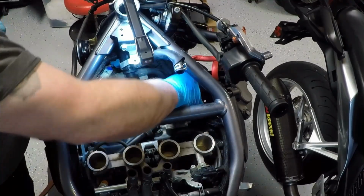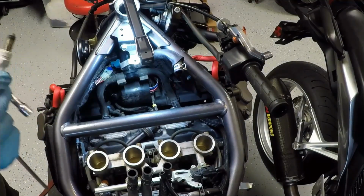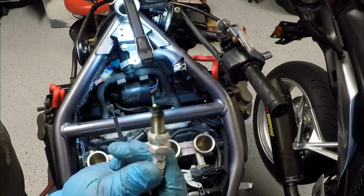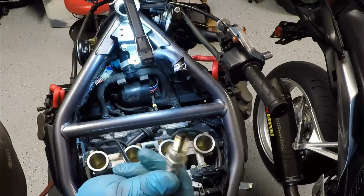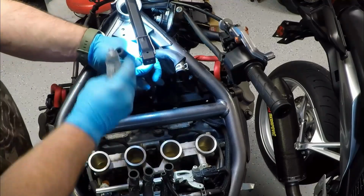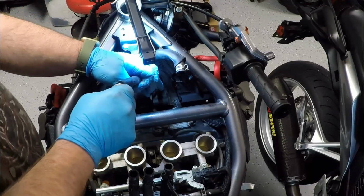I don't see the benefit of leaving plugs in the bike longer, especially when this is the sort of corrosion that can happen without your knowledge and result in a seized plug in the head. Break one of these guys off in your motor and you are in for some serious hurt. Better to change them regularly, and don't forget a little dielectric grease to ensure the leads come off easily the next time you need them out.